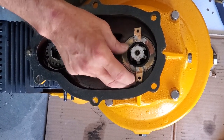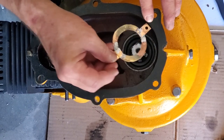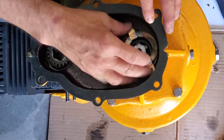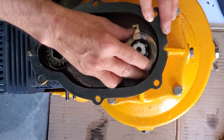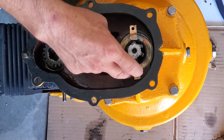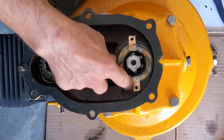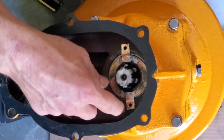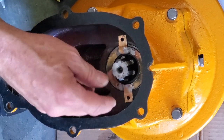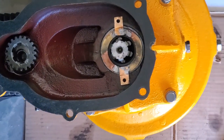And when I originally drilled this, I'm going to make sure because it's probably not 100% even. It probably has to go one way. So give me a moment, make sure which side has to go where. When I did this originally, because I said these were probably not 100% even, I put it in here, center punch, drilled one side, completely finished it, fastened it down, then did the other side so it would fit. But as you noticed, it only fits one direction.